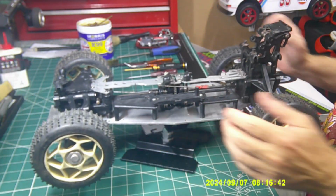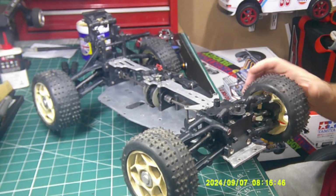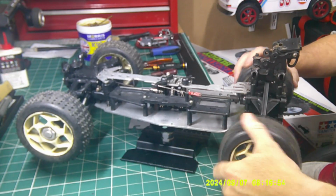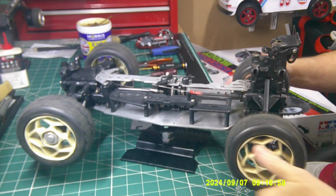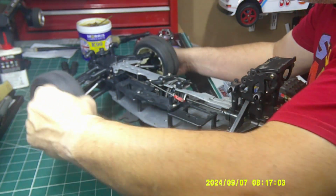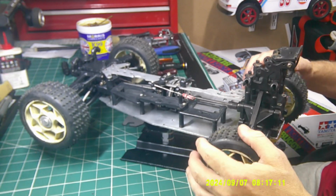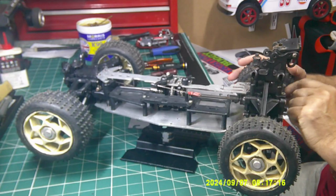So yeah, that's that back together. Looks good. Everything's free apart from that rear differential. As I said, it's not got a free up. It makes it almost like a solid rear axle. But the front one's really super loose. It's got quite a lot of play in there anyway because things are worn in the cups. But yeah. Anyway,